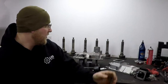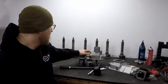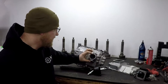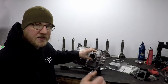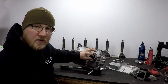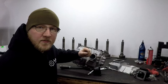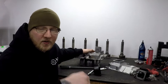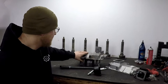We get a lot of 4500s in here and most that we come across have this round top shifter. It's fine, it works, it's got a wider shift pattern. The downside though is that they wear out right where the shifter ball is inserted under the spring tension and all the movement. The wear point is actually the top cover — you can see there's like a little beveled concave section in there. All the wear from the shifter movement and pressure is eroding the actual aluminum cover itself. When it gets out of spec or too sloppy it causes weird shifting because it's grinding your shift rail.